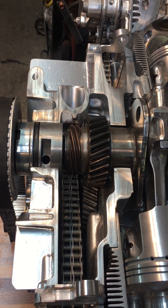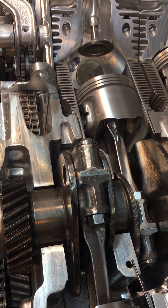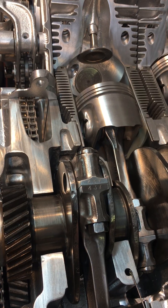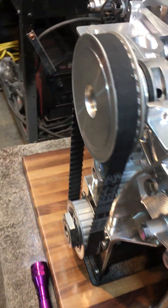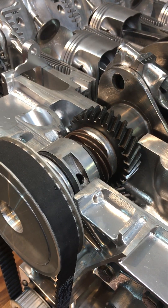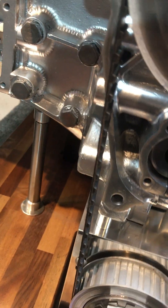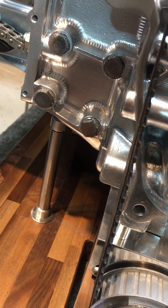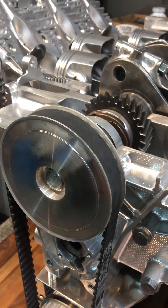The front bearing for the intermediate shaft is through this hole here, and there's actually a channel that goes down to the front of the rear bearing. I'm calling this the front of the engine, but I think it's actually the rear of the car. The intermediate shaft is hollow, and there's a plug here I've taken off — if you go in there you can put a few more drops in, and that'll cover the front bearing. So we've got the crankshaft and intermediate shaft covered.